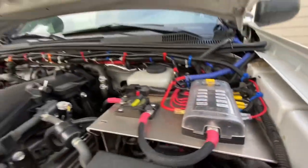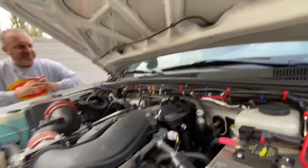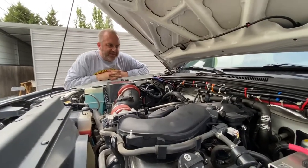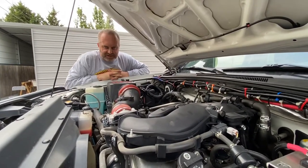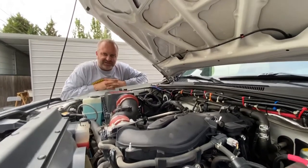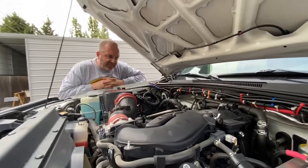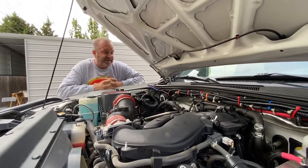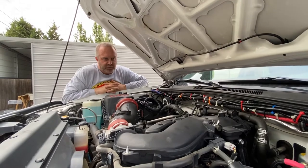You'll notice going across the firewall a bunch of cabling with multi-colored zip ties. I get a lot of flack for that, but let me tell you why I did it. Zip ties get brittle and they break under the hood with all the heat, so I came up with a method of having colors based on time, so I'll know when it's time to change out the red one, or the blue one, or the orange, or the white, and I just keep rotating them by color. It's worked out pretty well.